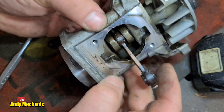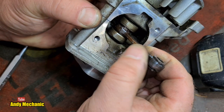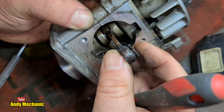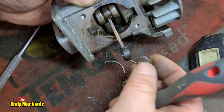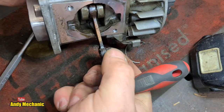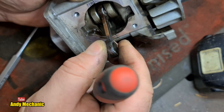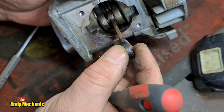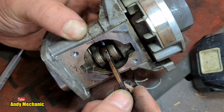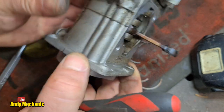Let's have a look at the big end — I say big end in the loosest sense because it's actually very small. This one here is the big end and this one is the little end. The little end — oh look, you can even take the bearing out. A little baby needle roller bearing which is still intact — well done little needle roller bearing. But I can't say quite the same about the big end — that's quite badly worn. That would have been knocking for some time.